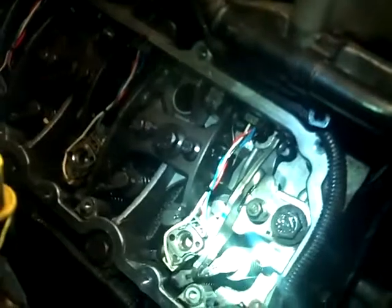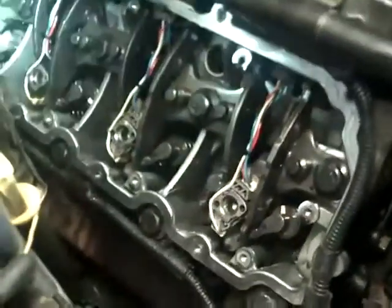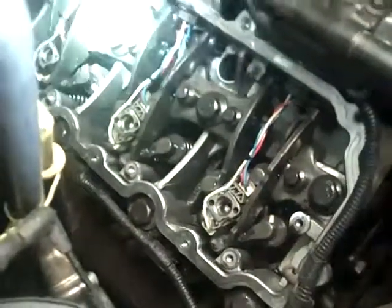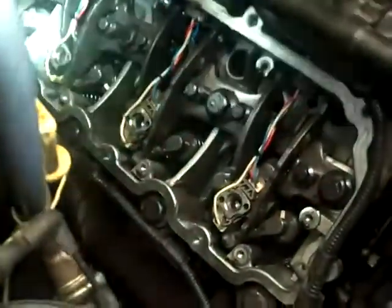We got no fuel getting jacked into the oil because we're running the fuel pump. We went to the inertia relay and put some juice on the big pink wire with black stripe. So we're testing and making sure we ain't going to have no problems. I'm going to let it run a few more minutes and finish this cigarette, and if we don't get no leakage, we're good.